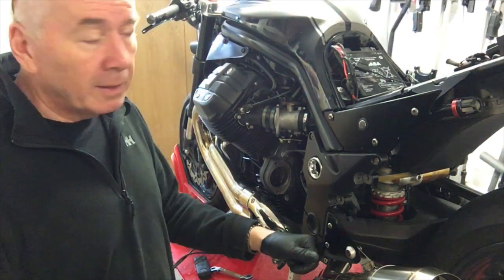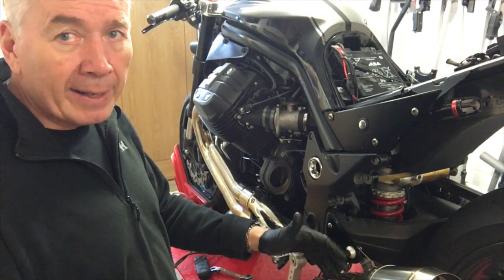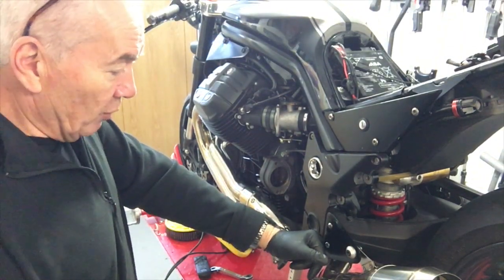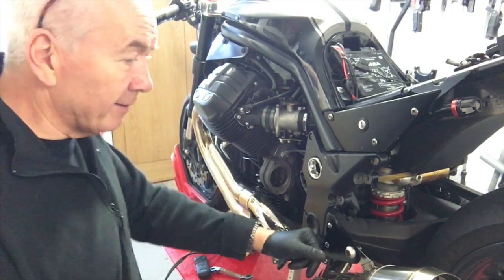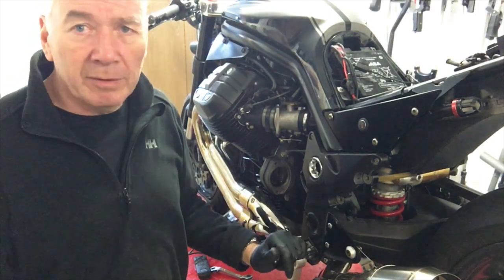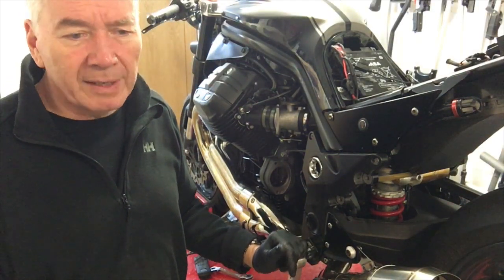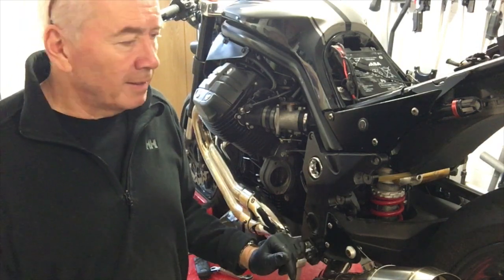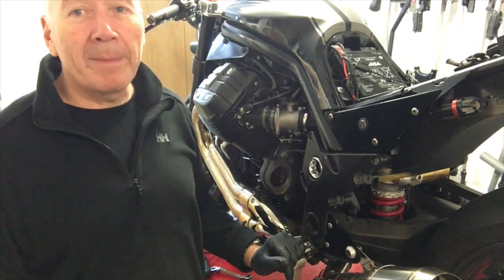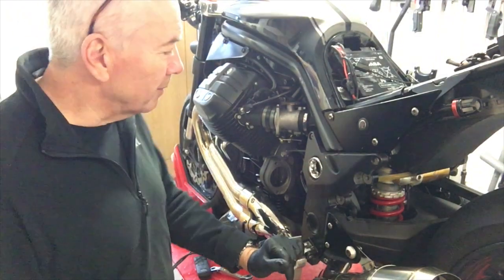Tried it again with a smaller fuse, and straight away, loud click of the solenoid, bang, fuse going straight away, which is not good. Since I did this fix some time ago now, I've been out on the road numerous occasions, no problem. Started it must be 100 times. Not once did it stutter or fail. And now we're back to the loud click, but even worse, blowing fuses as well.